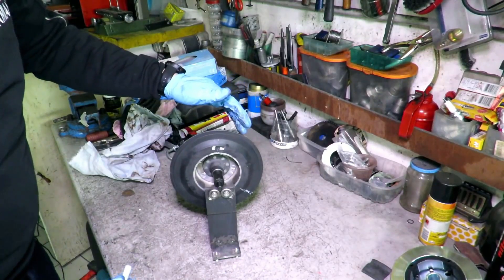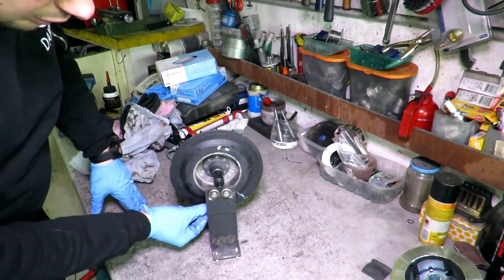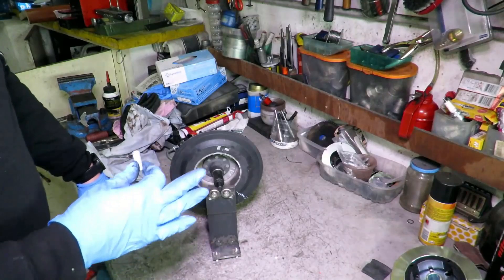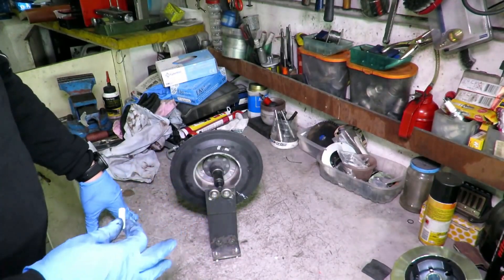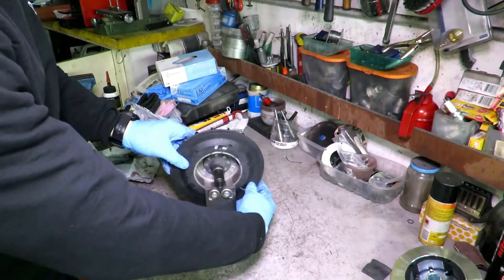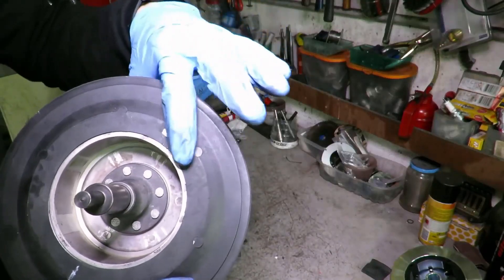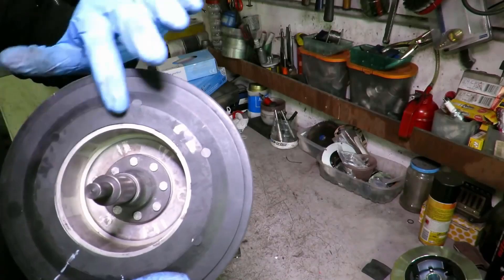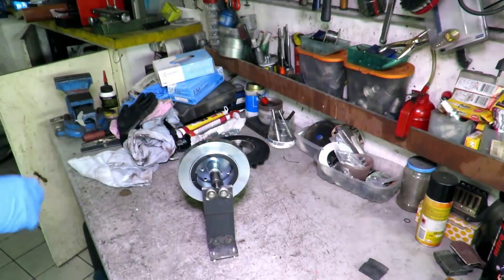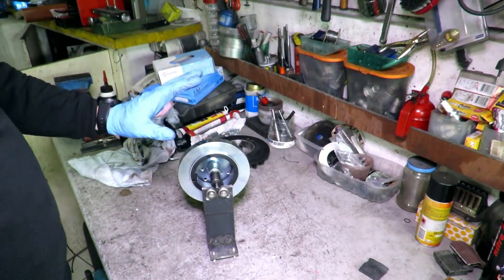It tends to return to the position, so I'll make another sign, always at 180 degrees. The imbalance here could also be understood from the conditions of the flywheel itself — because here, probably because it rubbed, there is no plastic, it has been filed. So probably either the shaft turned and it managed to rub on the crankcase, or something happened. Just to give you more information, let's see how the Parmakit flywheel, machined from solid, behaves.